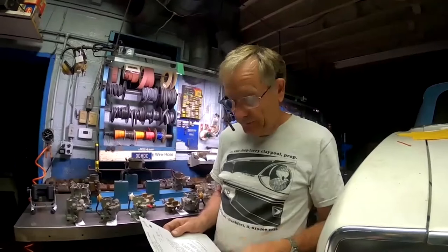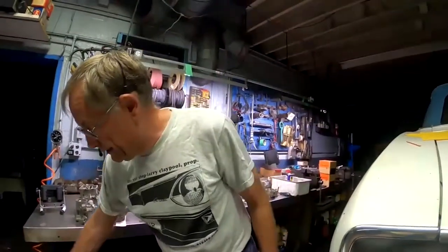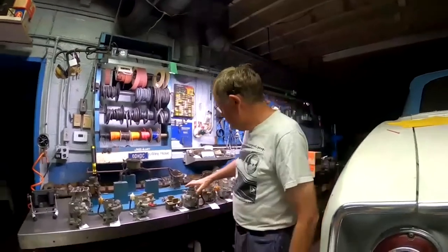And the carburetor should be modified as such. And the bottom line is they said they should replace the standard metering jet that came in the carb, which was typically like a 51, with a size 53 jet to enrich the mixture some. So, that was in 64, for high speed driving.